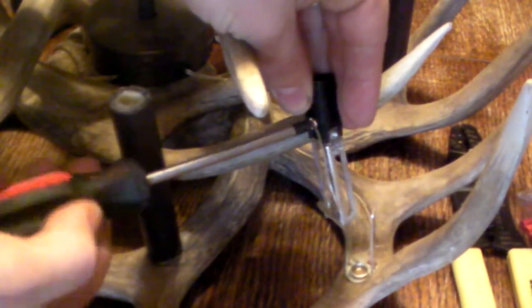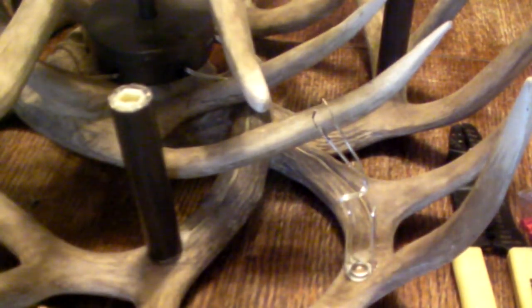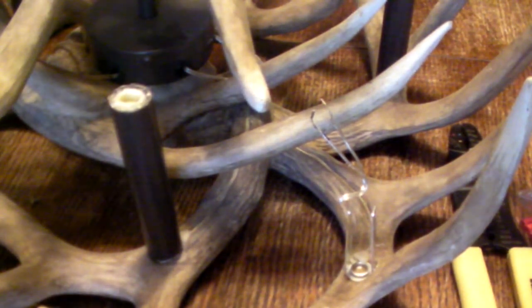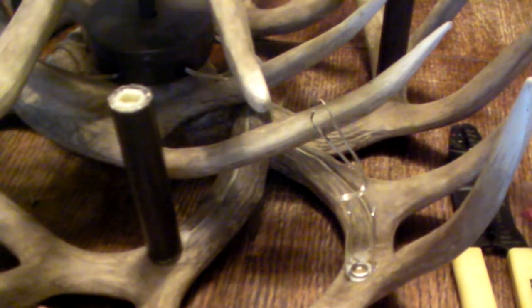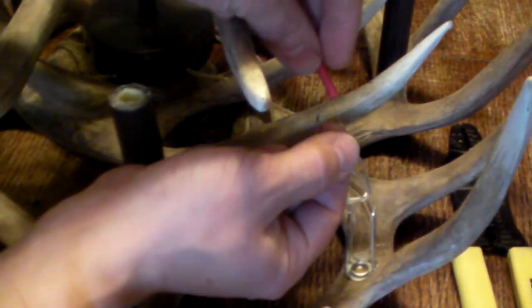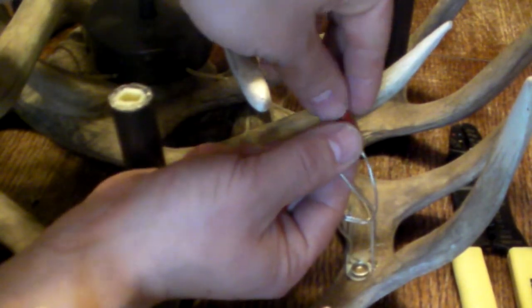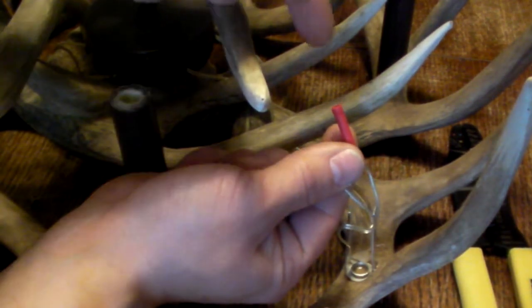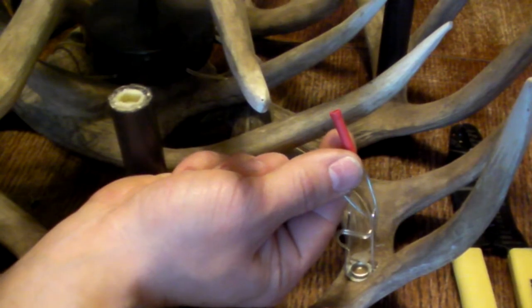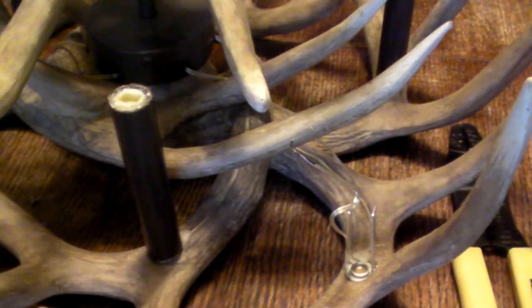Since they are a flexible braided wire, it should be pretty good wire for 12 volt wiring. All I'm doing is at a regular automotive store, buying 194 sockets — or pigtails if you will — which come with wiring. And inserting the regular appliance or light fixture wiring, but connecting it with the automotive socket, making it a 12 volt lighting fixture.